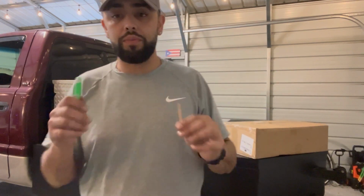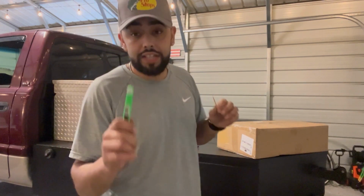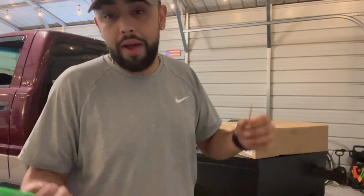So I heard a little faint hissing from the truck, from the headers, and there's bolts missing. The gaskets look pretty shot. So I got brand new gaskets. I don't know if I showed you those, but I have them over on the workbench. Brand new gaskets. This one should have came with gaskets, but anytime you buy some type of cheap headers, these were not eBay, but they might as well be.